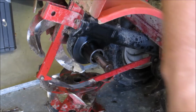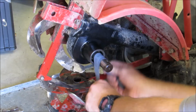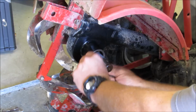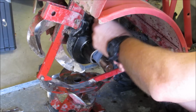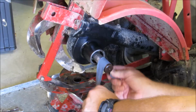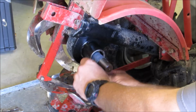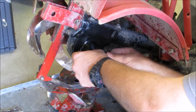All right. Let's sit down for this. Try to get up in there as much as you can. And then go back around. This is an emery paper. A fine emery cloth. See anything, go all the way around. I don't want to shoe shine it. It's the best you got to clean it up before that new seal can come on there.